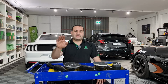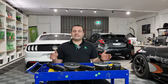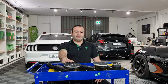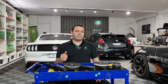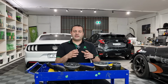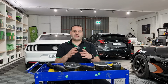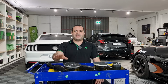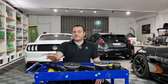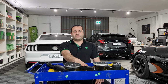This machine is fantastic for cutting. If you have a large panel and it's flat, this machine will cut better than the 5-inch. The reason it cuts better is, one, the size of the pad itself, which is 1 inch bigger. That might not sound like much, but as a percentage of surface area, I think it's like 20% bigger or even more. So the LHR21, the 6-inch machine, cuts better and faster. It removes defects quicker. It is noticeably faster than the 5-inch machine.